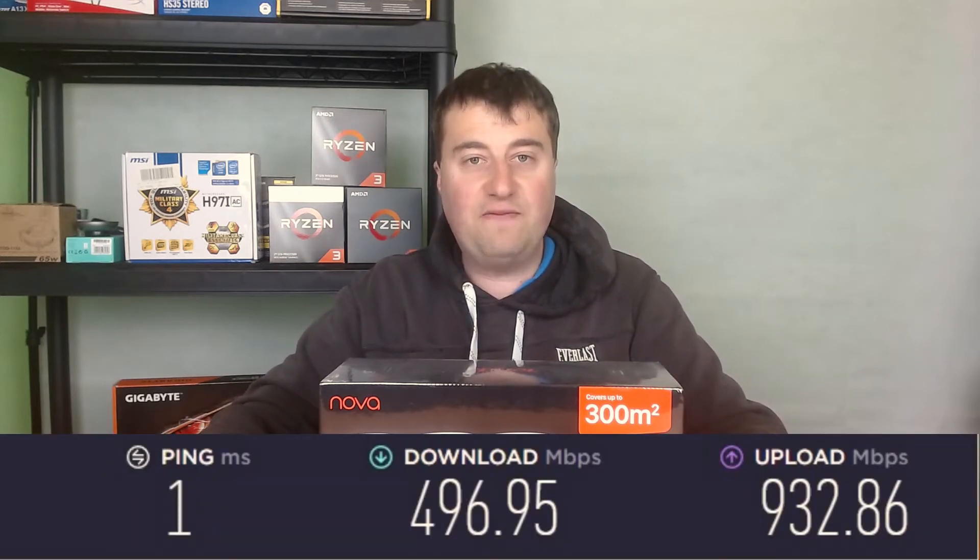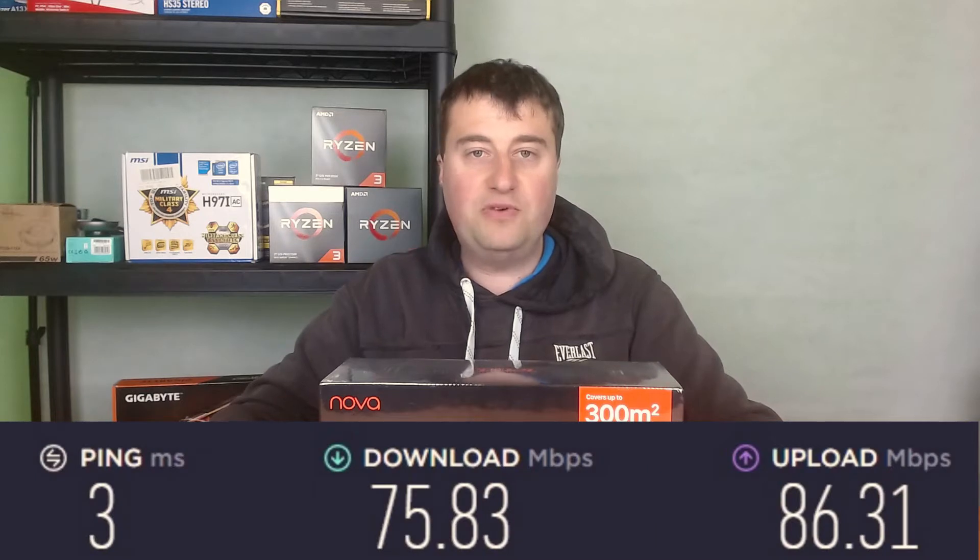I've taken three graphs before shooting this video. First, I directly connected a laptop into the wireless router with an ethernet cable — that was really fast, I got like 500 megabits per second. Then I connected to the Wi-Fi within the same room, the living room. That was a considerable drop but we still had about 75 megabits per second, which was actually pretty impressive.